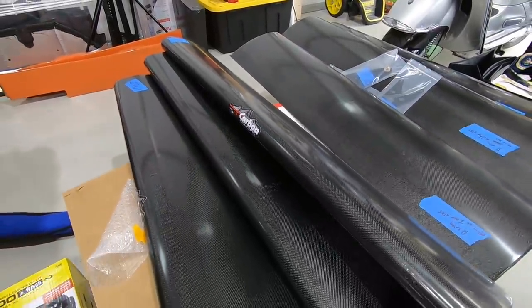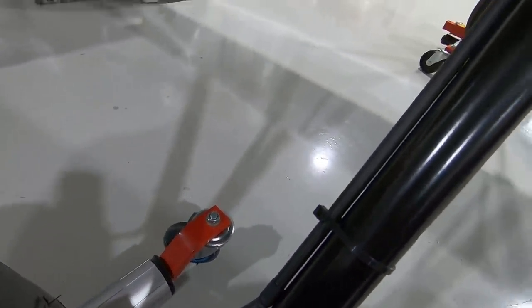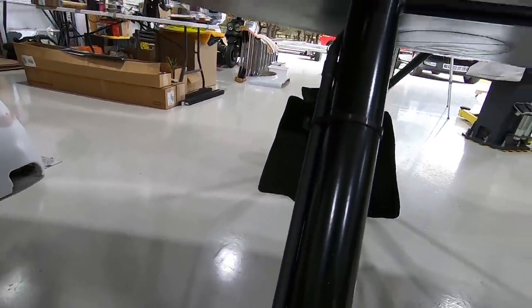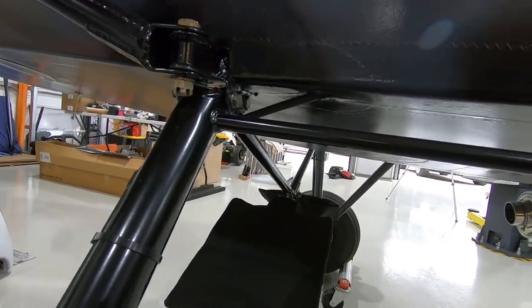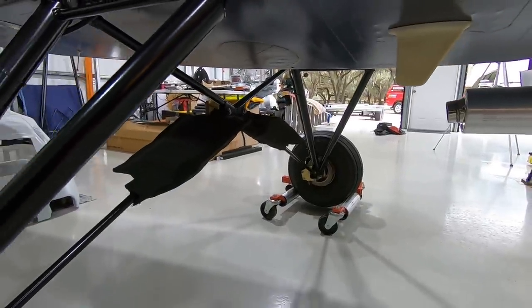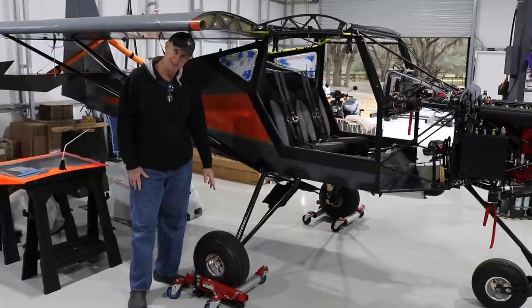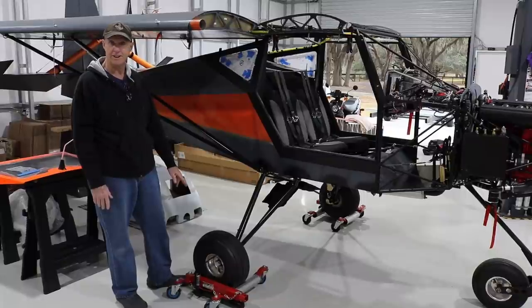The reason I stayed with tricycle gear — we're in Florida. We don't have public open spaces to land on unless you're invited, so we're pretty restricted. However, where I live in central Florida there are three or four hundred lakes, which is perfect, and eventually this is going to get converted to floats. So I went with tricycle gear initially. I went ahead and rebuilt the complete landing gear system — all new bungees, new brakes, new rotors — and the wheels are the stock 706 tires.